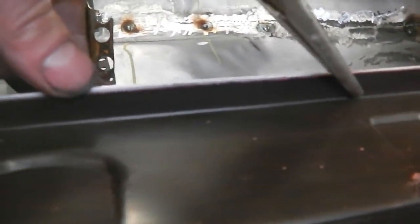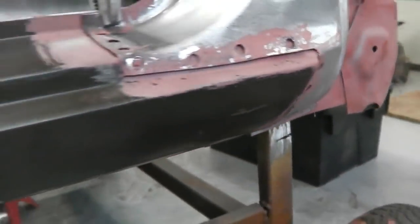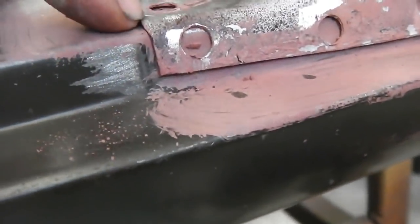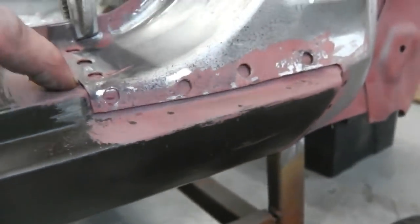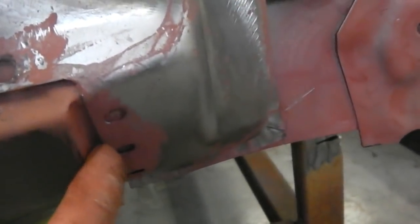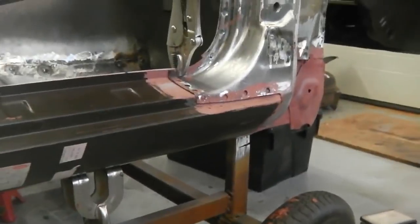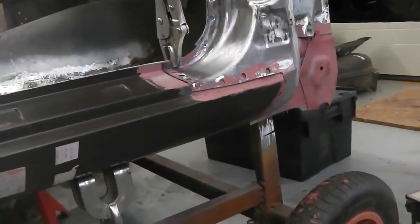You can see there, it's only because it's not drawn up, but even Fords never follow completely parallel, but we're pretty good. And butted up to the front as far as it'll go, up to this recess line. There's a little recess line built into the sill for this to bed onto, and that's just butted up against that. On these copy things, there's a bit of a difference here by a couple of mil on that nose edge, but it's covered by the wing. And I've seen them vary from car to car, so everything is in tolerance. As it happens, it's all in tolerance.